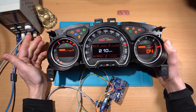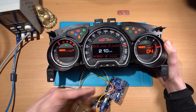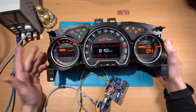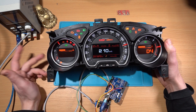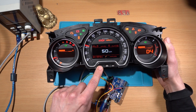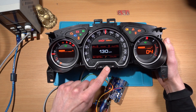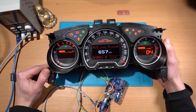The cheapest way is to display on the same display the car already has, so you don't need to connect any additional displays to the Arduino. You can also do the tests without extra buttons — why connect any when you have buttons right here? These buttons send a signal to the BSI to control backlight, but it's a counter on the CAN bus. Every time you press the button, the value on the CAN bus increases. So you can press it and see the speed going down or increase it. This is the maximum value you can send to the cluster for speed.